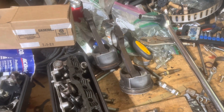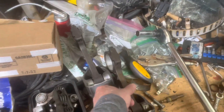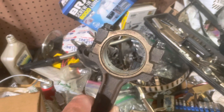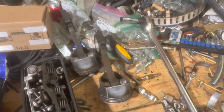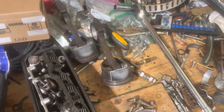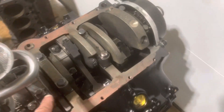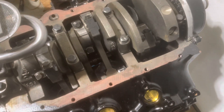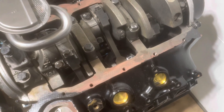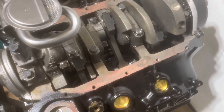Since I felt like I had damaged a couple of those bolts in that 4.3, I came back and borrowed some rod bolts from my LS engine rods and compared them — they were identical. So I went ahead and used them to repair this 4.3 V6. I loosened up the bolts, took them back out, swapped in the LS bolts, and this time torqued them to 15 foot pounds plus 85 degrees. That felt a lot better — not too tight, not too loose, felt about right.